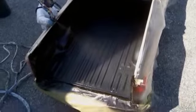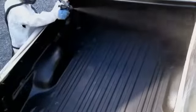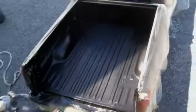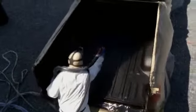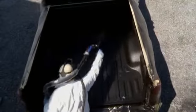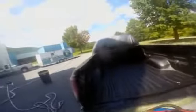For the most part, the plastic or rubber pieces in the front of the bed were an access hole to get it down the assembly line at the plant. There's never anything behind them. So we always ask the customer or the dealer, do you want them sprayed over or taken out? We prefer to spray them over because they're made to slip over a piece of thin sheet metal. When you put 3/16 coating on the bed, the plugs never stay in and never look right. So it's best, if they don't have a preference, to spray them over.